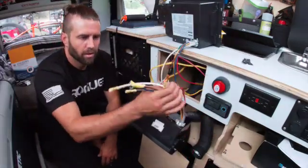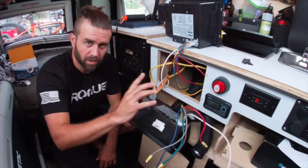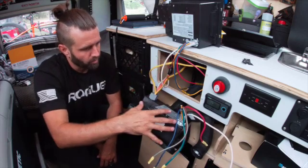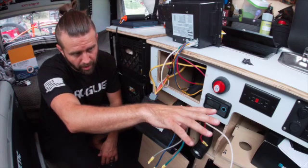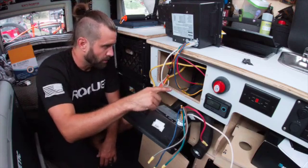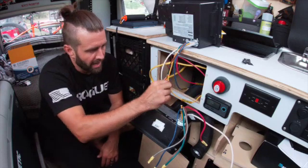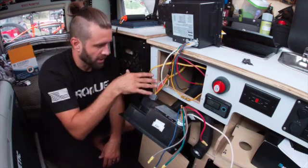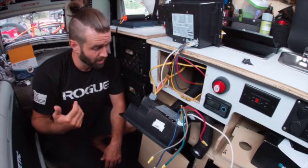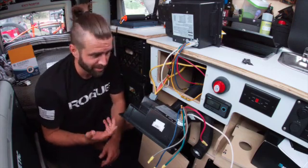Got all of our 12-volt wires disconnected from the old panel. What you probably didn't see in the sped-up version: the yellow wire that feeds back in goes over to the lighting and water pump panel, feeding power to that along with your heater controls. The wire is really short, so it has a pigtail back there that just disconnects. What I did is cut this end off and added it to the new controller. Once it's put in I can tie it up, but it gives me a little extra space so if I want to take this controller out to inspect anything, I won't be pulling that wire out every time — little trick there.